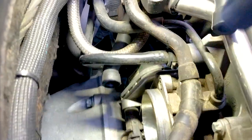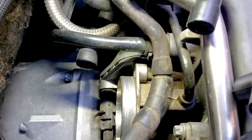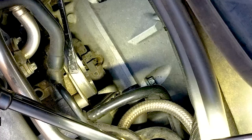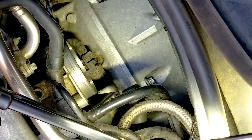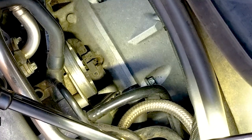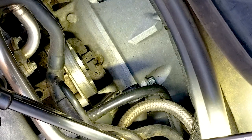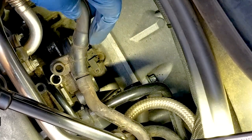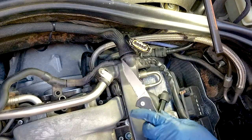If you have an OBD2 scanner, I have the Mercedes-Benz Star Diagnosis System, but I also have one I bought cheap from Amazon for $15. If anyone is interested, write something in the comments and I'll let you know what I purchased. With an OBD2 scanner and the right software, you can see the live data and see how many grams per second is moving through the MAF. For these cars — the S500 — you want it to be close to 5 grams per second. If yours is lower, it needs some cleaning.